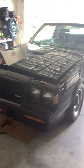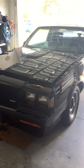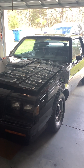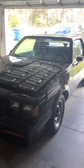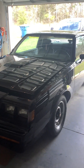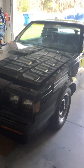What's going on everyone? This is gonna be a quick video about my Buick Grand National. Bought it a couple months ago, had a couple problems with it — nothing serious, just needed a basic tune-up, it wasn't running right. The biggest thing was it had some really old varnished-up gas in it, so I pumped all that out, put some fresh gas in, did an oil change and ran it. Done a couple cosmetic things too — new carpet and such — and I got it pretty much ready to go.